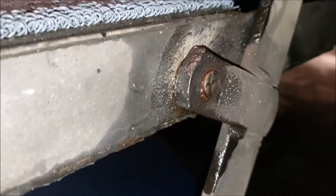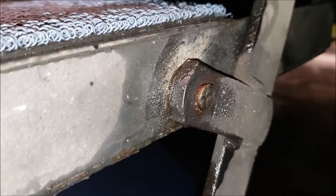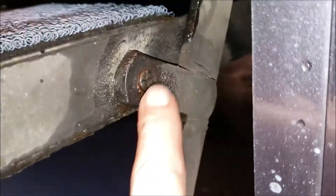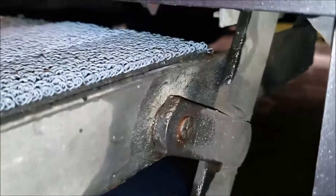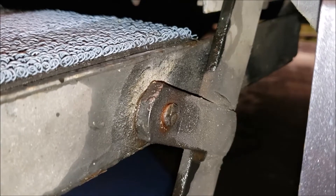Okay, there's one — see that wiggling? So the best way to fix that is raise it up, and while it's raised up, take a spot welder and weld it. I had to do that to mine. So that's a little weak point that needs to be taken care of. All the other ones are tight. On his step, everything's good except for this one little rivet. That's something you want to catch before it goes too far. You can just raise this up, put your little block under it, raise it up, take a little stick welder, and put a little dot of weld — that'll take care of it.